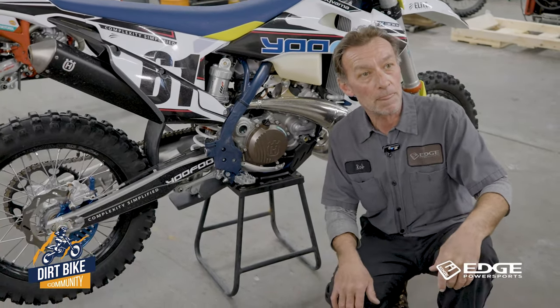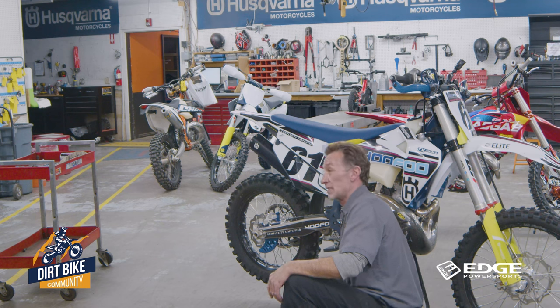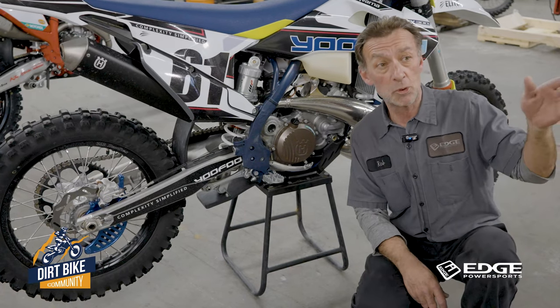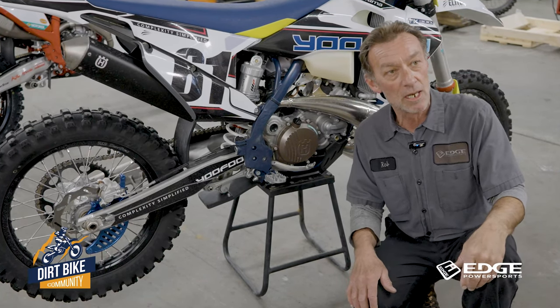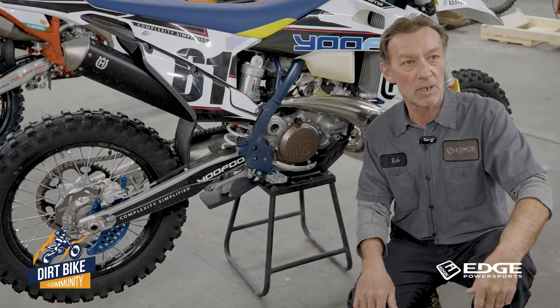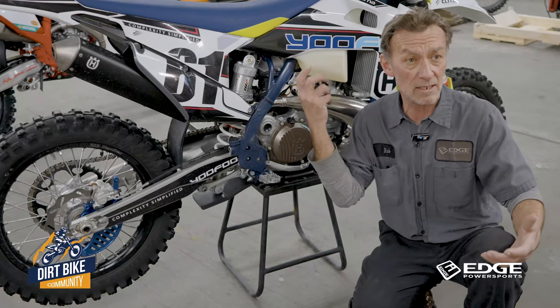As a novice, would it be more beneficial to have the suspension a little soft? Definitely, because that's going to give you better handling. It really depends on the environment you're riding in, but if it's set up too stiff — say you're doing hard enduro — it can deflect you right off the side of a mountain. You want the bike pliable so it works well for you. The goal is for the bike to work for you as the pilot. Pro riders always want it stiffer because they're jumping higher and traveling much farther through the air.